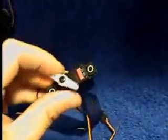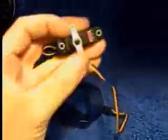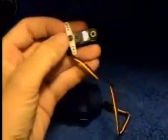That's all it is. Remember, you're pulling on the servo strength from here towards the outer edges. You're not actually using this to hold the weight. You're not using the side-to-side action to hold the weight. You're using it long ways, pulling from the center of the servo. You can increase your weight exponentially doing it that way. That's a lot better than using bomb bay doors.